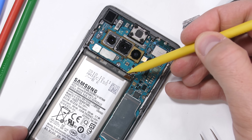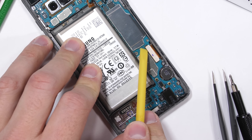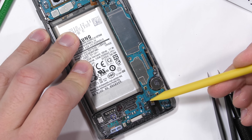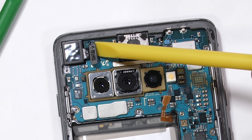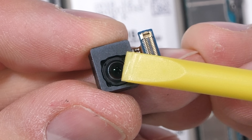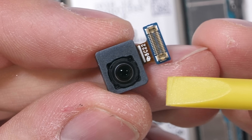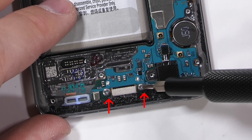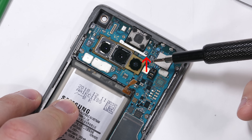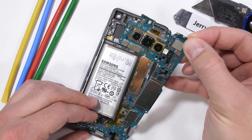I'll unplug the battery and take out the SIM and SD card tray. Then I can take my plastic pry tool and unclip the screen ribbon just like a little Lego. The headphone jack ribbon and the front-facing 10-megapixel Cheerio camera also unplugged — no optical stabilization on this little guy. There are two screws down at the bottom supporting the charging port, and another silver screw up in the main chunk of the motherboard. Once those are unscrewed, the whole motherboard can come loose from the frame.